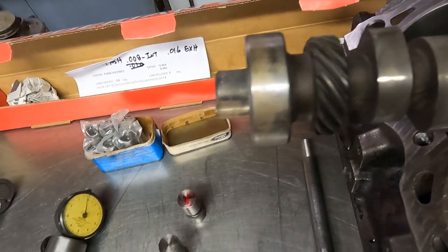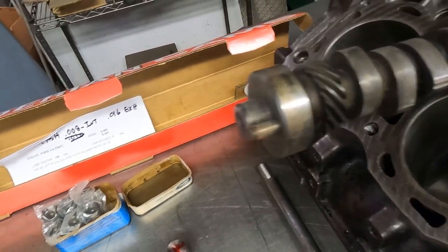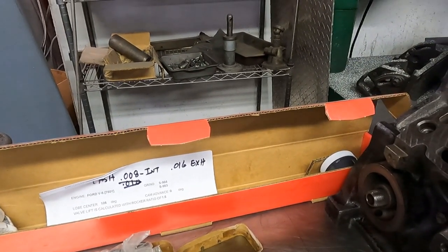As you guys know, the lifters have a crown or a radius and the cams are tapered. One of the things that professionals and guys that are in the know will do is try to check their parts — measure the taper across the cam and make sure it has the right amount. We'll just put a cam in a lathe, put a tenth indicator on it, and sweep across the lobe to see how much it has.